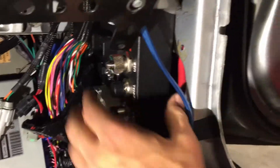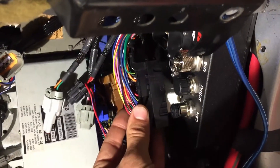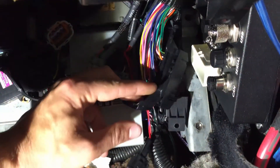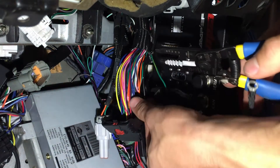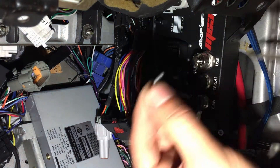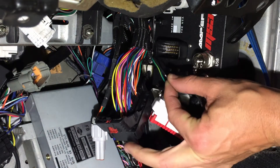With how crammed this whole area is, this is really the only spot I could make work. So I went ahead and re-drilled the holes, got it mounted, it's secured — I got three out of the four bolts holding it in. Now that that's done it's time to start wiring. I have the connectors here, the old connector is right here, and as you can see it reaches the farthest connector. So there's going to be no issue with wiring directly from where I cut the crimps. I'm trying to cut as close to the crimp as possible so I can get as much wire as possible, maximizing my space because this wire is very limited.